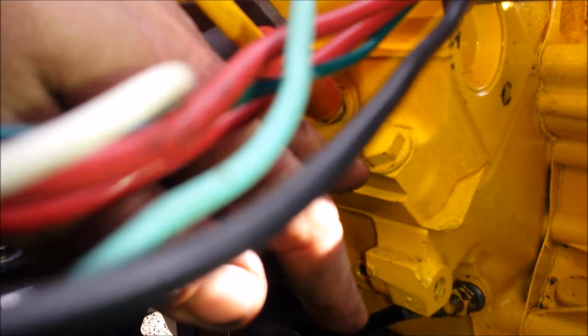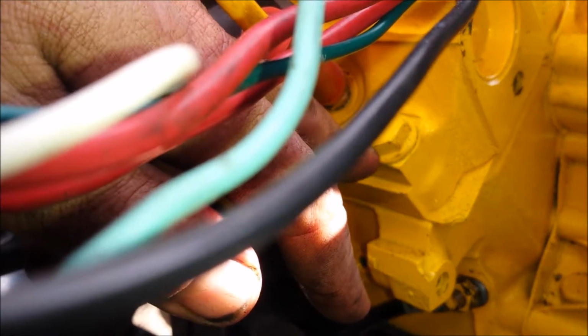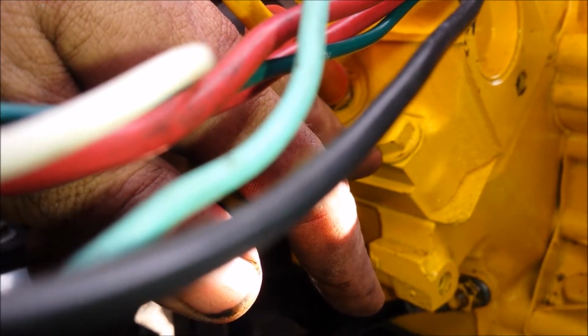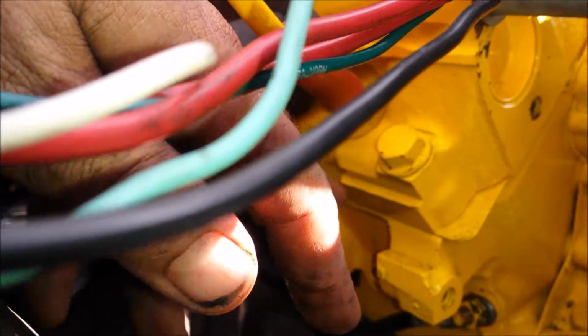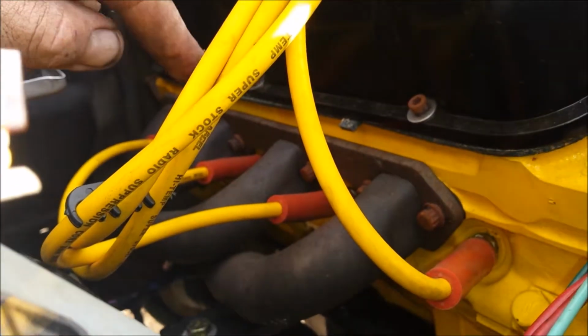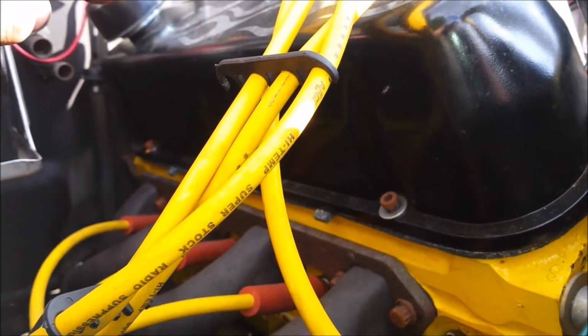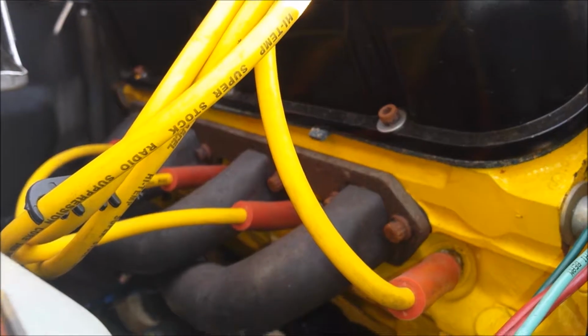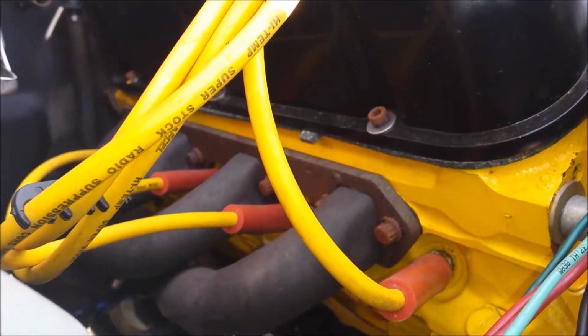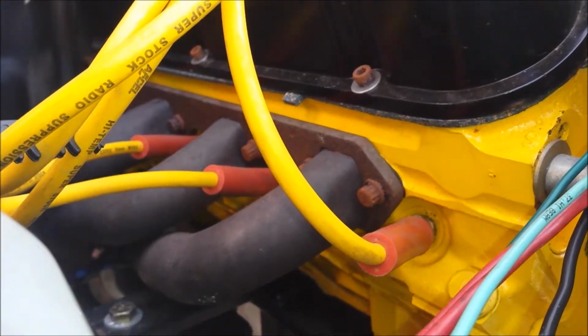So I put the torque wrench on this bolt right here and set it to 70, and I actually got it to turn before it clicked to 70. So what I'm going to have Robert do here real quick, and it's going to take him some time, I'm going to go work on the ram charger while he takes his valve covers off and tries to double check all of his head bolts, before we try to refire this thing up again, because it's not good to have head gaskets that don't do their job.